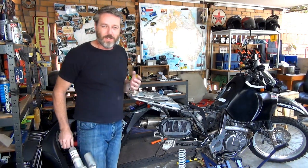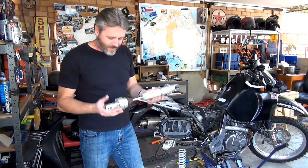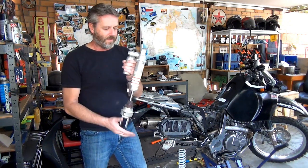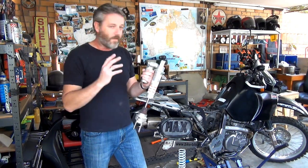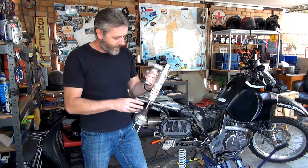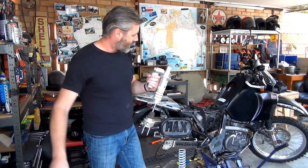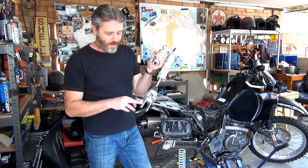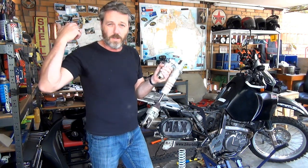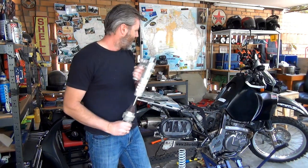But yeah, hopefully if you're attempting that, if it was that one bolt, if that had come off all right, the rest of it would have been a breeze. So now that's going to go up to Vince Strand. He's going to do his revalve thing. I don't know how it works. And then I've got that new 8 kilogram spring, so he'll revalve this, attach all the spring on there, have all the adjustments where they're supposed to be, and basically I'll be able to just whack it in. I'll have to get a new bolt for there, so I either get it from the local Suzuki dealer, or I'll give Vince a ring and he might have one that he can send down when he sends all the other stuff.